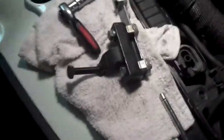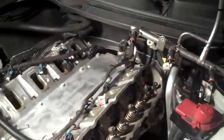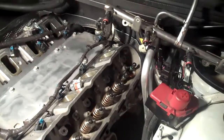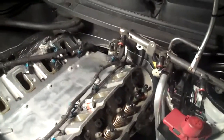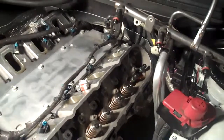I did lubricate the tool and did everything properly — I used the base and lubricated the inside of it. But I was having trouble getting the keepers on because the spring kept getting off-center of the valve. Probably two to three times I would compress the spring and release it, trying to reposition the spring so I could get the valve centered properly. On what I believe was the third time, I finally had it just right and had it compressed.